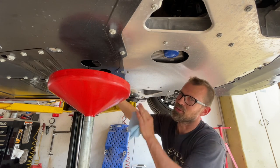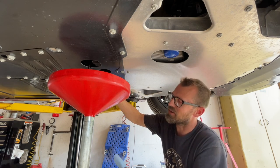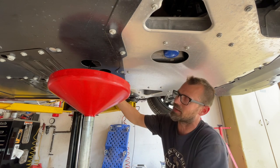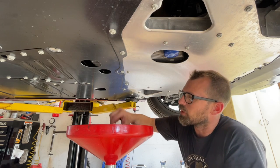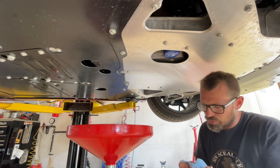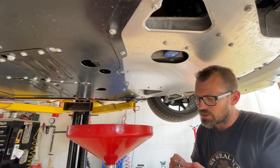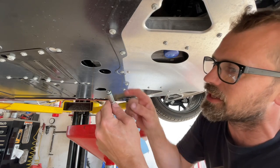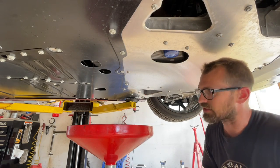This thing is warm, so this oil is coming out fast and you don't want to spill a bunch on yourself. You probably don't want to do this when it's really hot, but this is not too tough to deal with since we've got it up on a lift and we've got the drain pan up close. We've got it down to a trickle, so I'm going to pull the drain plug out. You do not have to change the o-ring on this, but it does say to inspect. There are actually two gaskets on this — one around the base of the plug and one at the tip — so you just want to inspect to make sure they don't look damaged. If they look fine, you can reinstall it.